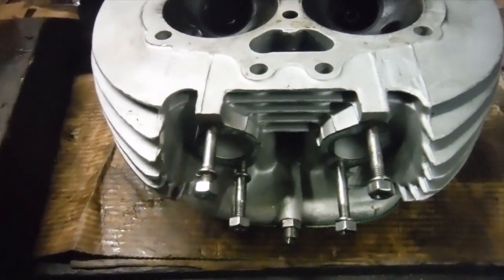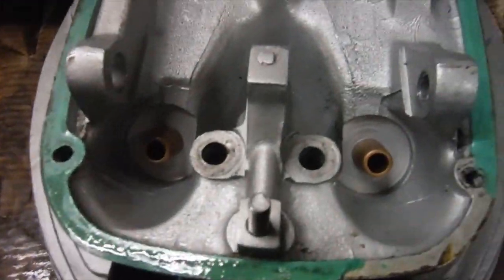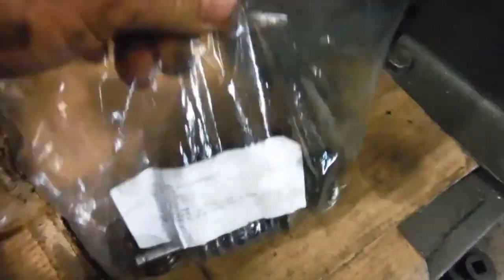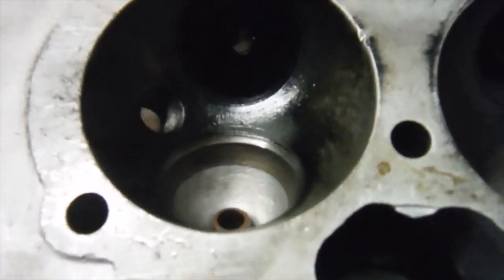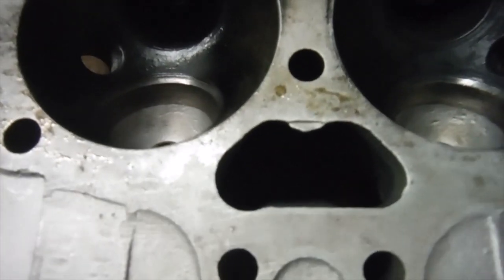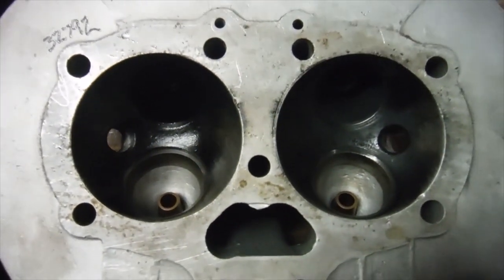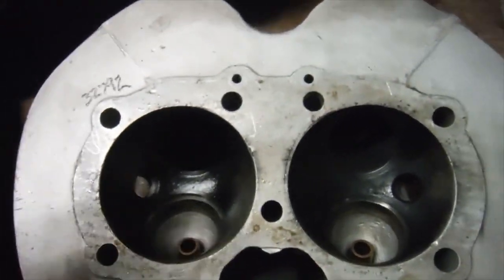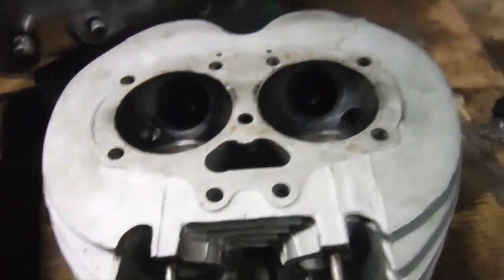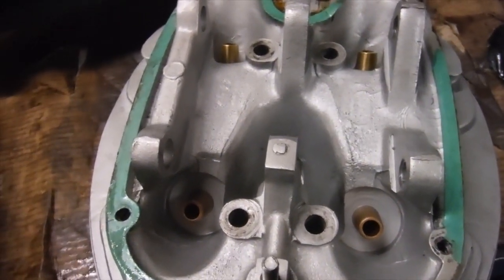You're stripping down an engine because it's making noises - well your inlet manifold is going to be the cause, isn't it? Any fool knows that. On this side we have to play 'guess which valve went where.' There are two exhaust valves and two inlets, so that narrows it down to a 50-50 chance. With a bit of experimentation - dropping the valves in and using clutch and brake cleaning solvent - I should find out which combination holds liquid best. That's what I'm going to do next: check what condition they're in and how well they seat.